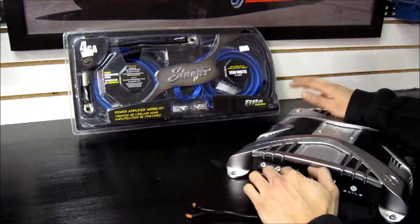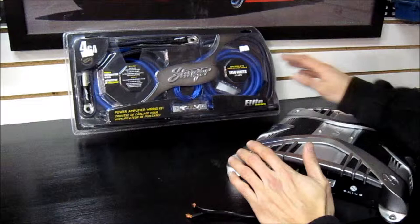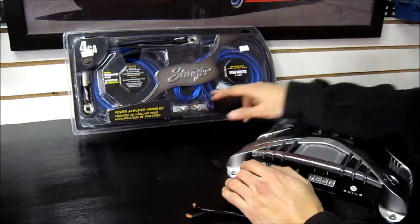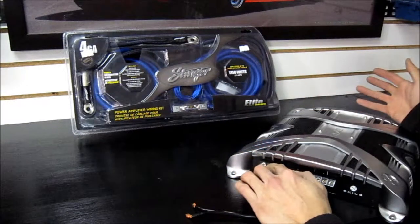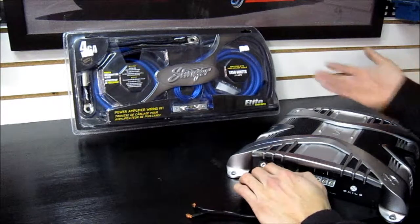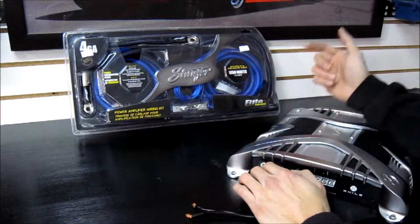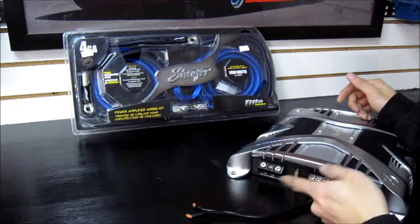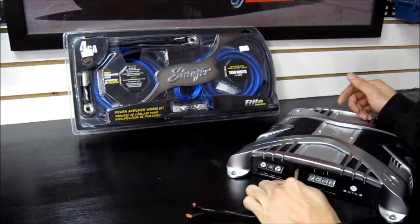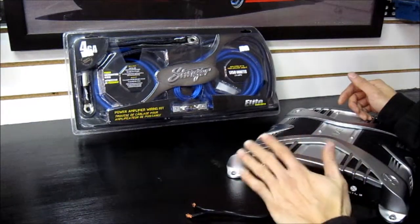For safety's sake, if you run thicker wire, there's no point having a 175 amp fuse — it'll never blow. You can step it down to something smaller. In my truck, my Pioneer amplifier can only pull about 60 amps — it came with a 150 amp fuse, so I put a 60 amp fuse near the battery instead. If you have multiple fuses, just count them — so if there were three 25-amp fuses, that equals 75 amps total, and that's the minimum your wiring needs to handle.